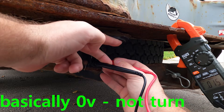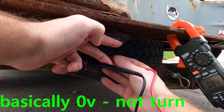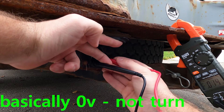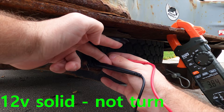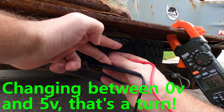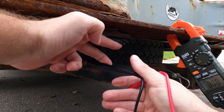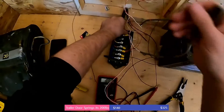Assume you'll have to chase down every circuit using either a voltmeter or a testing light. Hopefully yours will conform to an existing standard, but don't depend on it. This does get back to the 'diagnose any problems' point I mentioned before — because even if the wire colors are wrong between your car and your trailer, if you get a new wiring harness with new terminals it's very quick and easy to switch wires inside your trailer to the matching terminals.